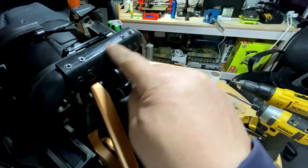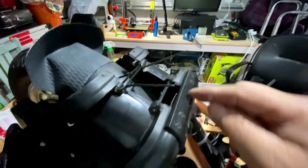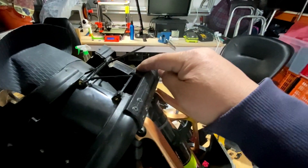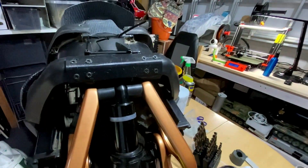At the moment it's temporary - using a cable tie to join them together to pull them in - but this seems to be working perfectly. So I will print another one on the back on the bottom which will link that up as well. And I also have some long screws which will be replacing this cable tie. I will put that in there - it's 80mm long - and that should straighten this up once the screws are in.